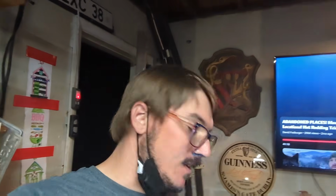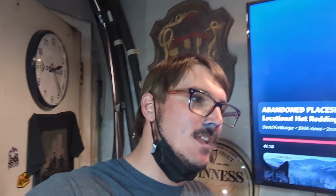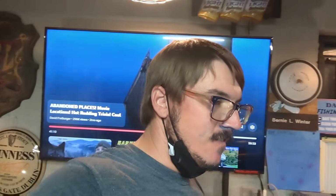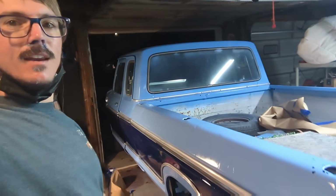And then if you shook the can, stood it upside down for a little bit, let it sit for a minute, and then sprayed it, it would start to come out right. So what I started doing was, when I had a fresh can, I would make sure that wouldn't be a final coat, and I'd put that on something that just needed some extra coverage, and then I'd go over it with another can. Problem is, the very last can I did for that top rail, I ran short. I had to use a full can. So I had to go in with a fairly full can, which gave us this slightly lighter bedside.